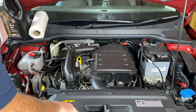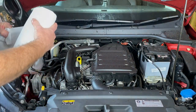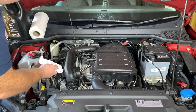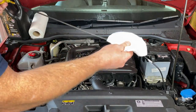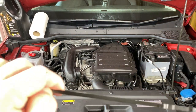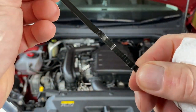So to dip the oil, get a bit of kitchen roll, pull the dipstick out and wipe it clean initially. We're just wiping it clean so that we've got a good starting point, and then what we're after is a reading.